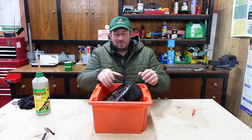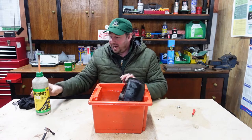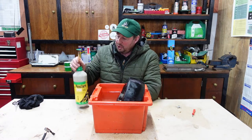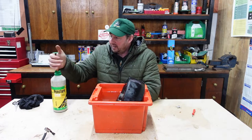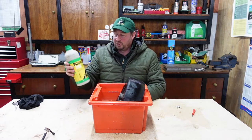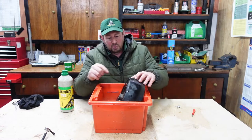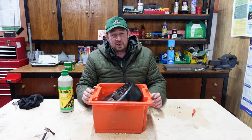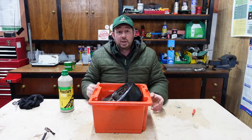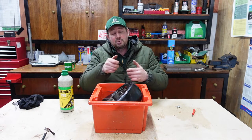We've got the bucket set up full of water — you can see I've got a wheel in there. This isn't the first one we've done today; we've done a few. The reason I'm filming now is we've got a new tub of sealant and there are a couple of things you need to do to make it work properly. If you've got a bigger wheel you either need a bigger tub, or just use some soapy water in a spray gun, spray it on, move it around slowly and see if there are any perforations.